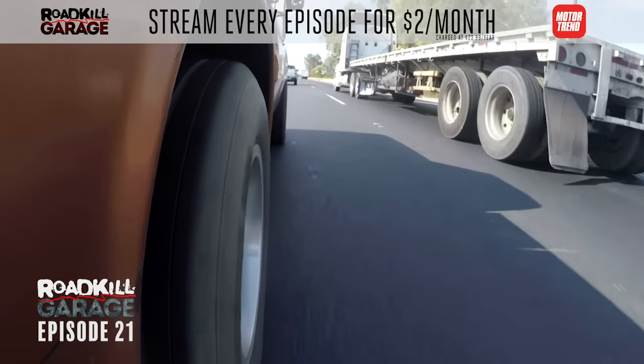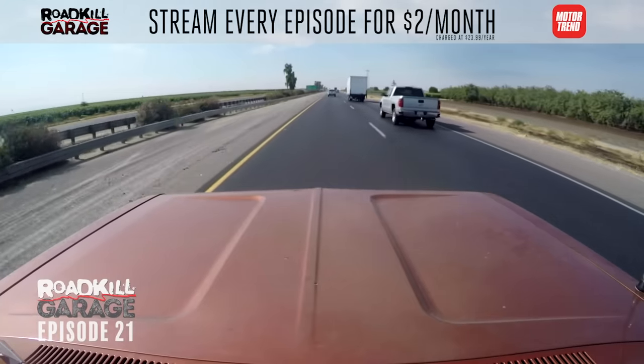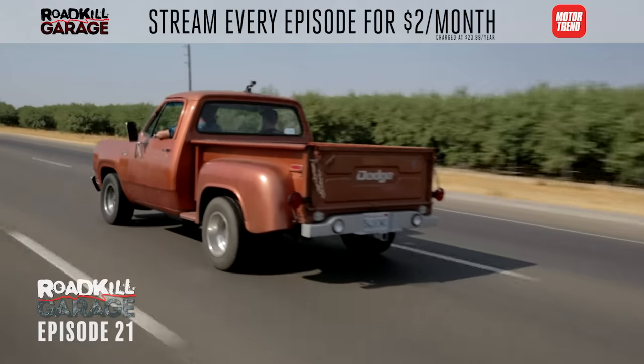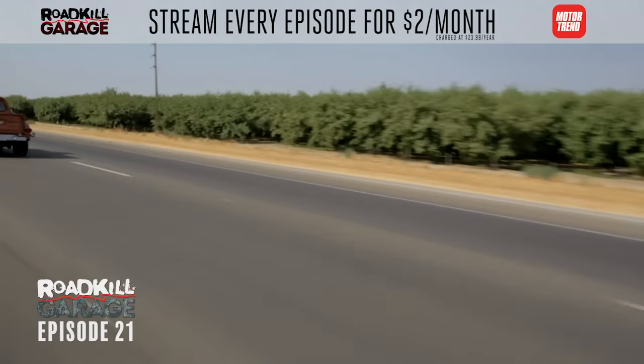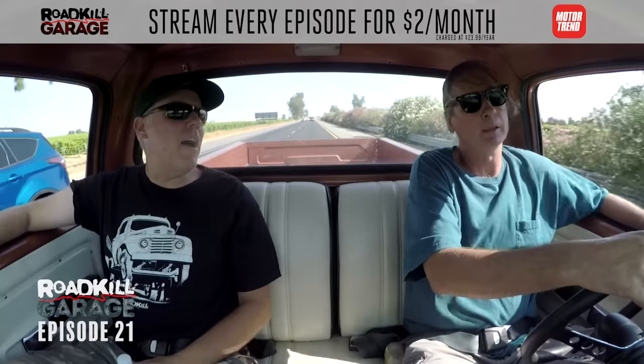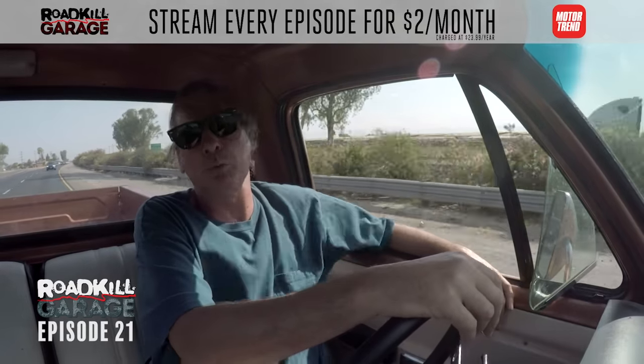This is the type of engine everybody says don't put in a truck because it's got a giant carburetor — probably too big — and a single-plane intake manifold, too much camshaft. But it doesn't even feel like a first drive with a new engine because everything is going perfect. Cruising at 2,100 RPM, 60 pounds of oil pressure, 160 degrees. With the windows down though, I get my hair in my eyes — I might need a haircut to drive this thing.